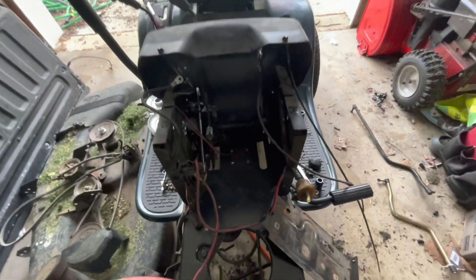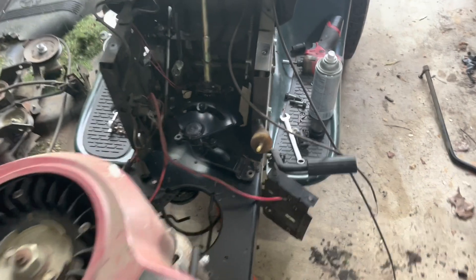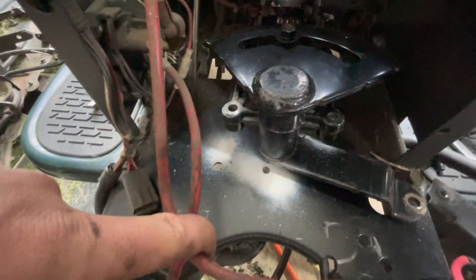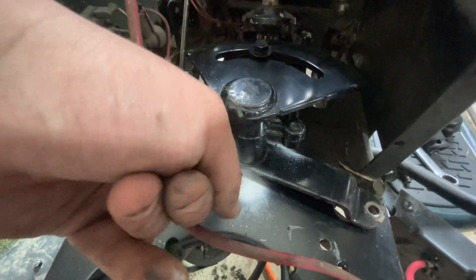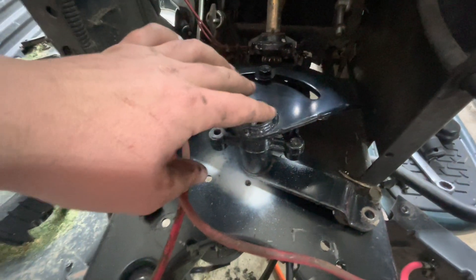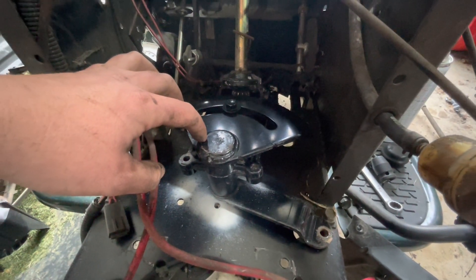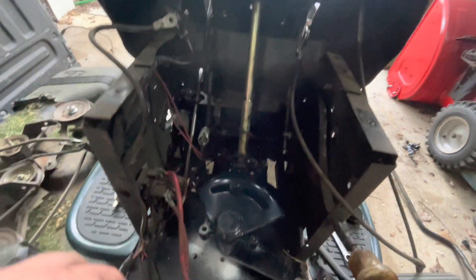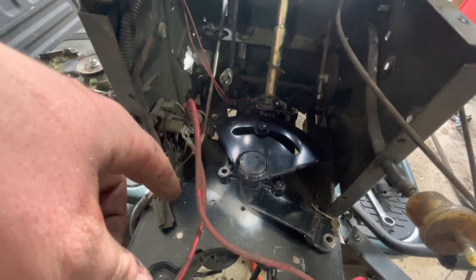Next step is mocking this all up and cutting the hole. Here's how I mocked it up: I ran it through, set it on top of the frame roughly how it's going to go, and threw a couple spots of spray paint down to mark the center. I'm going to drill a square, leave some space in front, drop this in, drill the holes for where the bolts go. I'd say it starts about three and a half inches back from the engine hole.